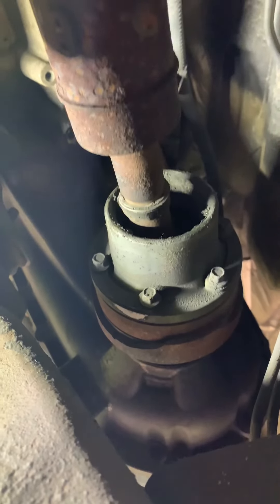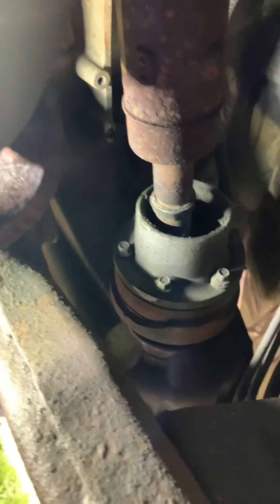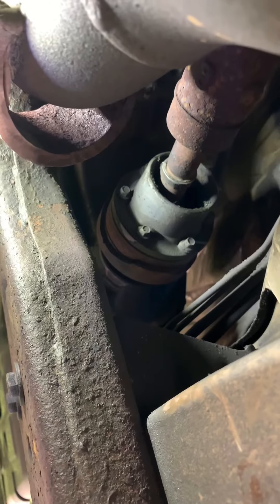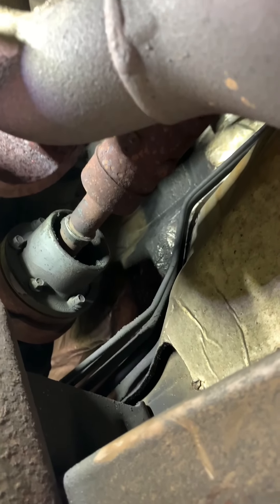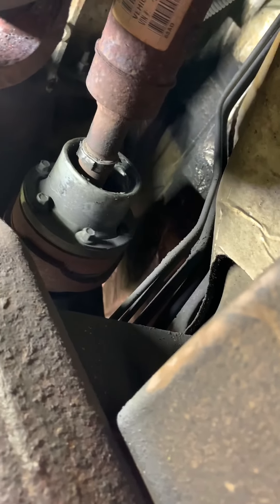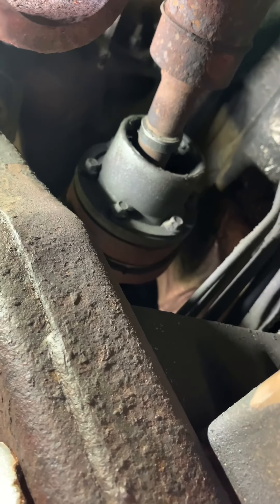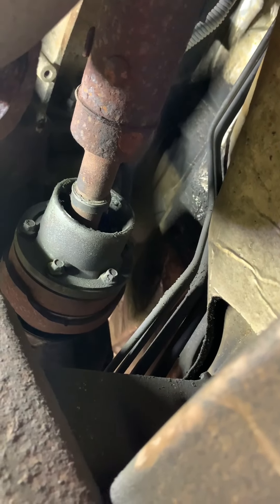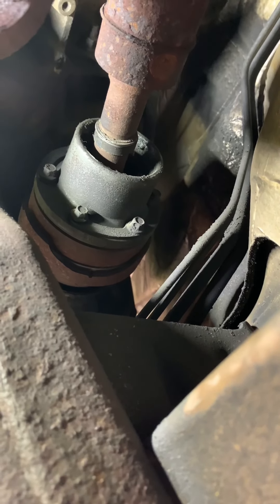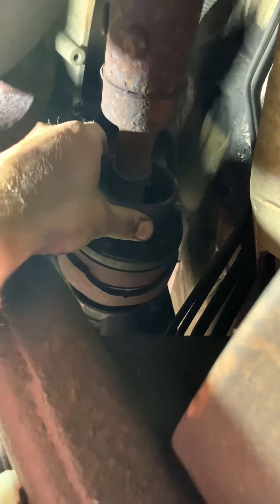So now I'm trying to figure out if this will cause hesitation even when you only have it in two-wheel drive. I believe it does, because let me spin one of the front wheels — oh yeah, so that spins. So right now this is in two-wheel drive. So all this front is going to spin even when not in four-wheel drive. It's just not going to get torqued from the engine — it's just going to be free spinning. You wouldn't think that would cause a lot of resistance, just free spinning, but it must.